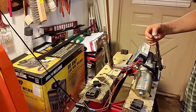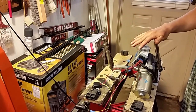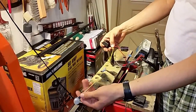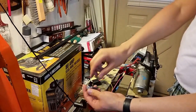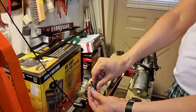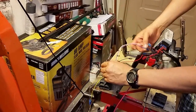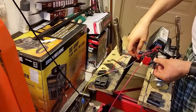I don't want to cut the shaft in my car and then find out that this doesn't work after I've already cut it. So what I did — this is really simple — this control unit just has six cables. Two are connected to a potentiometer, which is used to change the level of assistance that you get. All the way to the left is no assistance, all the way to the right is maximum assistance, and you have a lot of settings in between. Two of the other cables need to be linked to the two cables coming from the controller box.